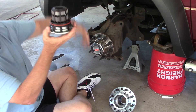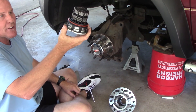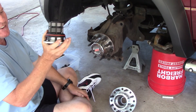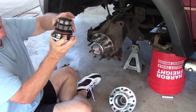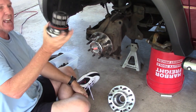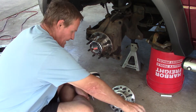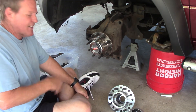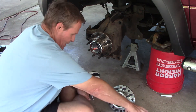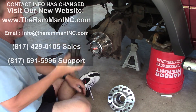This was one of the key failures of the vacuum hubs in the 90s that kept people from getting out of tough spots. The vacuum motors didn't have the power to overcome the springs. Sometimes they wouldn't engage, sometimes they'd disengage. Everybody in my generation remembers those damn vacuum hubs — they wouldn't engage, wouldn't disengage — they weren't worth a damn, basically. That was the first attempt before axle disconnects, and that's why they didn't work very well.